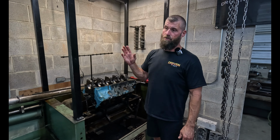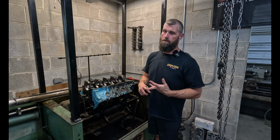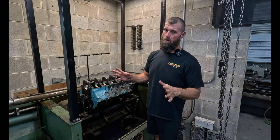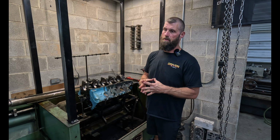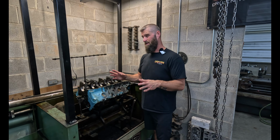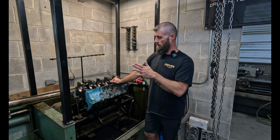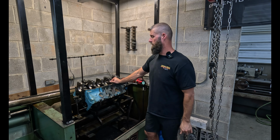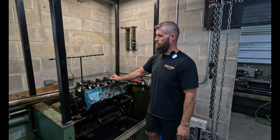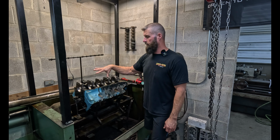And that explains why the crank and the bearings were just absolutely destroyed. I mean, it looked like you've been running 0W rocks and gravel through it. So they was all scratched up and trashy, and that makes perfect sense, because as bad as the tunnel was, and then the size was all big too. So that's that.